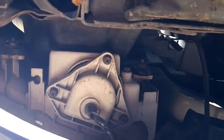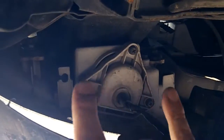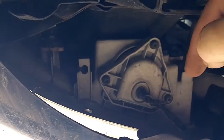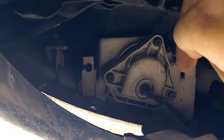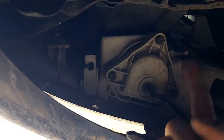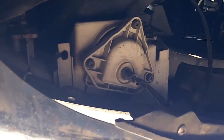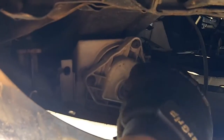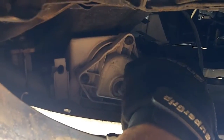The fog lights only come on the V6 version of the 626, and it's an optional package at that. There are two bolts — one here, one over here — and the bolts come from the fog light and go back. There is no mounting bolt from the chassis to the fog light; it's the opposite way. The mounting bolt is on the fog light. One concern with the Mazda 626 V6 fog lights is that the mounting brackets have a tendency to break, so be real careful and gentle when you take those off. Don't over-torque them because they're held on by plastic retainers.